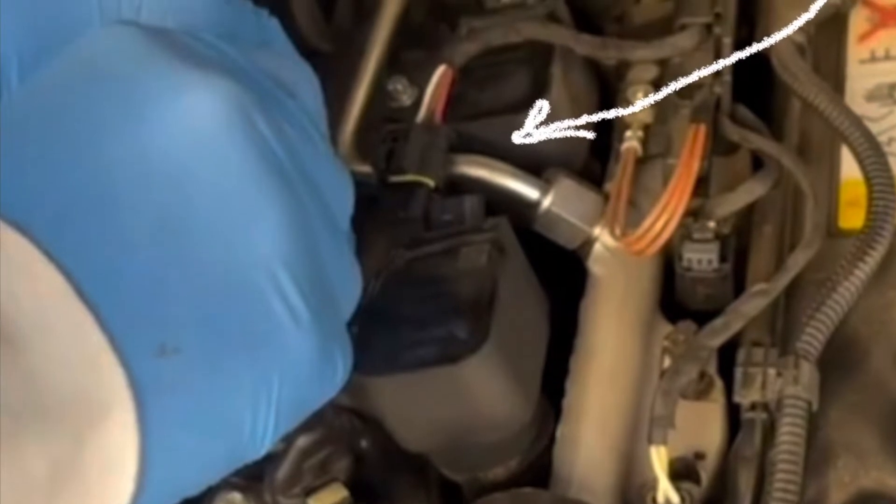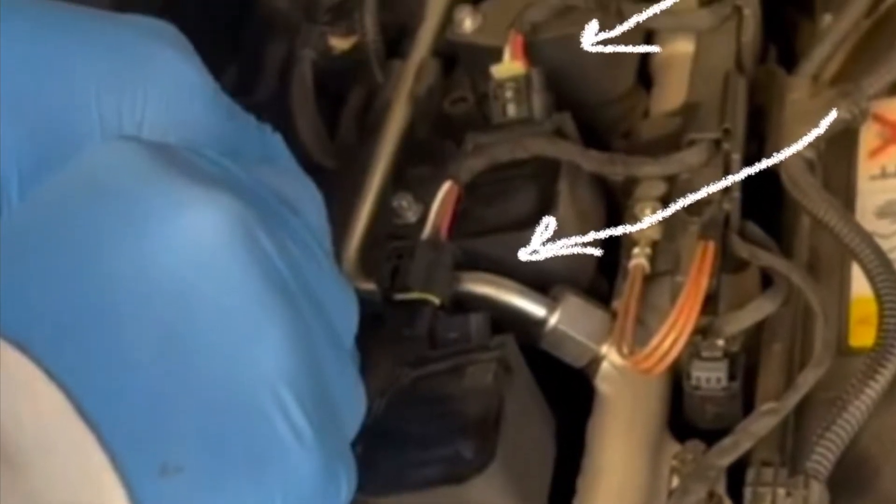When you disconnect that metal thing from the coil pack, if you can take the coil pack out without fully disconnecting the cable, that would be easier to just change the spark plugs. Obviously if you also need to change your coil packs, you'll need to disconnect the cable. So try it first on one coil pack — unscrew it, pull it out, and if you can pull it aside with the cable, try it like that so you don't have to mess with those plastic clips. Those things are so annoying. I'd put a small screwdriver in trying to pull out that white thing, and then the sensor comes out. If you can't do it without disconnecting, just pull the coil pack and change the spark plug — that would be easier. But if you have to change the coil pack, you'll have to disconnect it regardless.